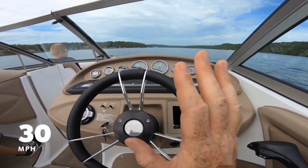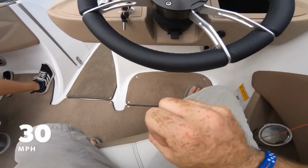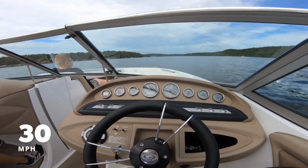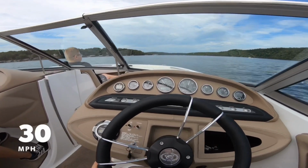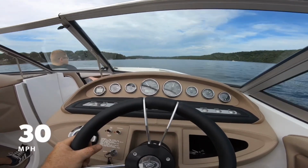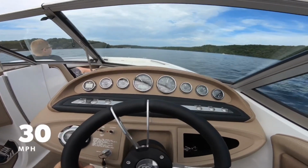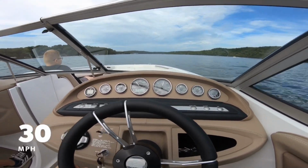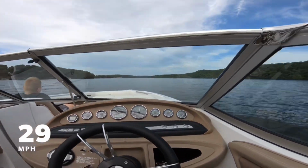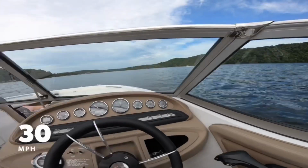Oh yeah. So right there with just 3 clicks, I could feel in the floor the boat just release, like take a breath of fresh air. So right here at this speed, we're running about 30. Keep in mind you're looking at the GPS screen. I could do this all day. Extremely economical fuel burn speeds are under 3,500 RPM. And the fact that we can still run 30 and over and stay under that 3,500 RPM range is significantly awesome. Right here, boat's running great.